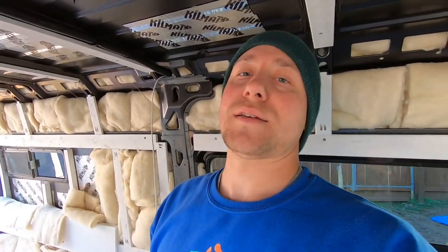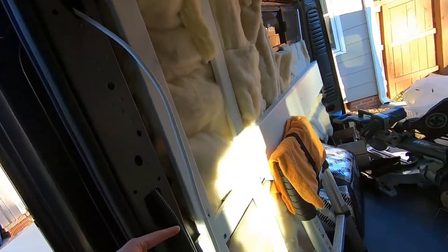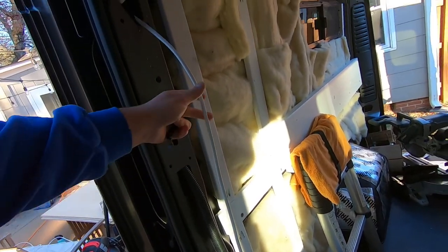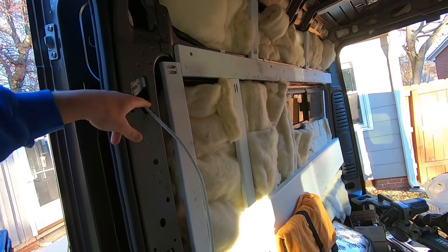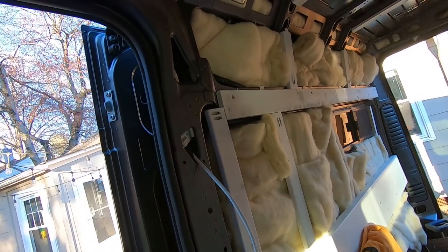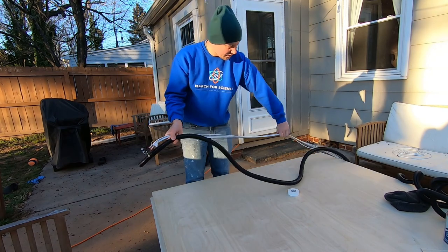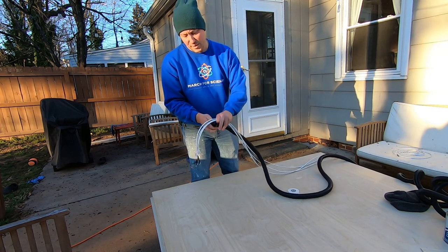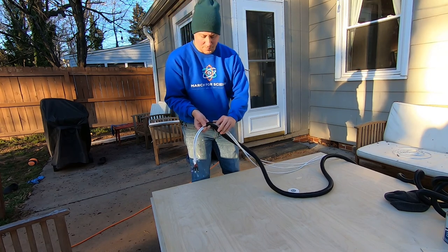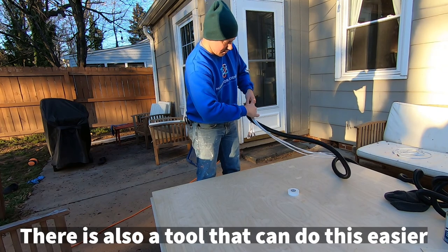We'd still be able to unhook it if we had to. Running that across and down this pillar - the pillar ends here so I wasn't able to go further, came out and went back in. That's for our switches at the door, and this is for our kitchen cabinet lights which will come into the cabinet somewhere. I'm going to put loom around anything so there's no vibration and sharp sheet metal isn't tearing at the cords. These are wiring for a USB and two reading lamps for our bed.